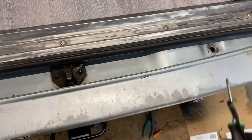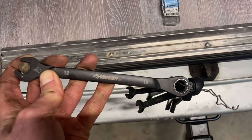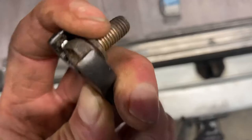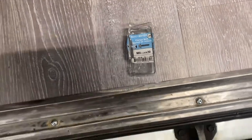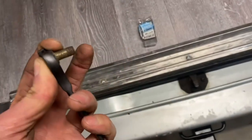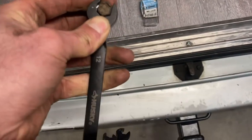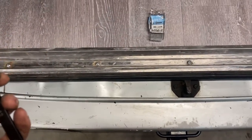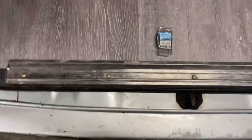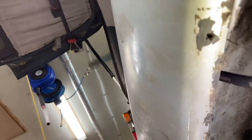It's held with four M12 bolts, accessed from underneath going in towards the frame. By M12, I mean it's a 12-millimeter bolt head. I think the threads are M8 1.25 — the size and pitch of the threads. I don't know a lot about metric bolts, but the wrench or socket you need is 12-millimeter. I'll keep calling it M12 — so grab a 12-millimeter metric wrench.